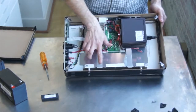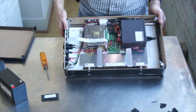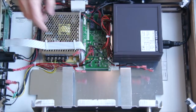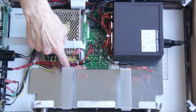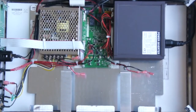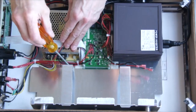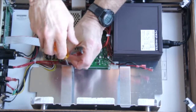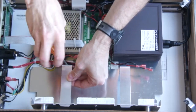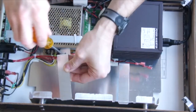Here is the unit. Here are the battery straps — this is where the batteries sit, and here are the connectors to connect each battery. Now that we have the case open, we can have access to the two battery straps. Each of the straps has a screw located at the top that we have to undo to remove the straps. And this is where having a magnetic tip Phillips head screwdriver would be very helpful, because you don't have to try to reach in there and grab it. If I pull up and help it along, I can remove them both.